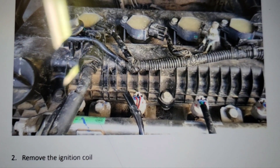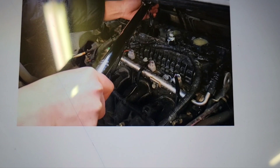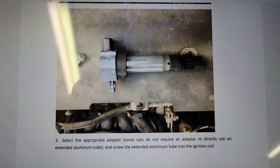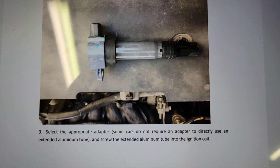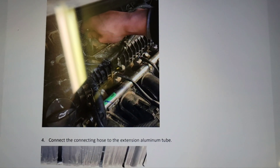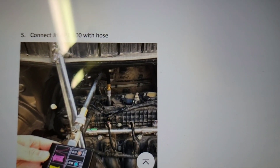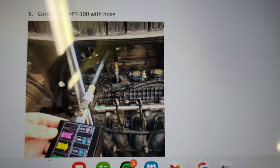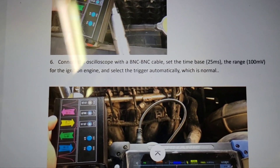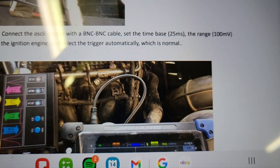We have the battery charged up. We're removing the coil — already have that done. First we're doing it in clear flood mode, so we don't need to worry about the coil firing just yet. When I do a running compression test, we'll trick the coil into thinking it's still firing in the cylinder — it knows it's firing somewhere, but we're not damaging anything. I already have the hose and transducer in the hole using the straight hose, not the aluminum tube. It doesn't come with a forward adapter, but I had one from another compression gauge.